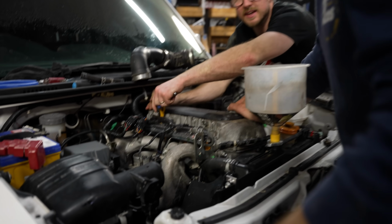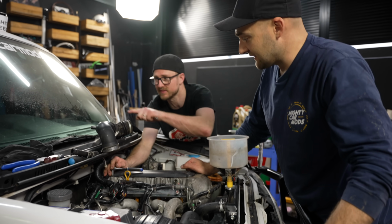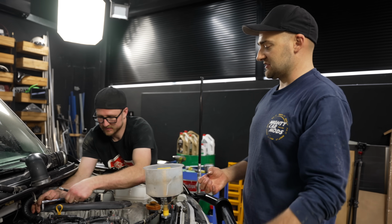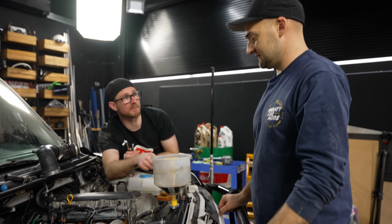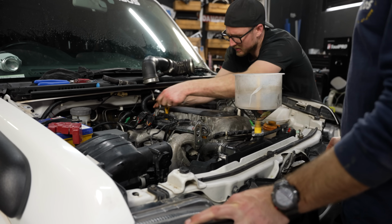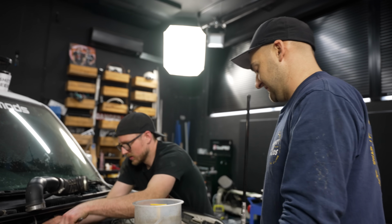So what you're saying is catastrophic head gasket failure would do this, no coolant. Oh yeah, it'll take coolant from there into the cylinder and push out the water exhaust. And any compression it is making is sucking all the coolant out. It was bubbling like mad as you were cranking the engine, like a big water pump, and those plugs got wet instantly. So yeah, no coolant in it. I don't reckon it's going to start at all, or it'll sound really upset.